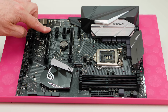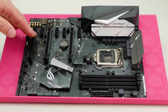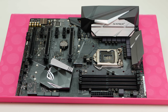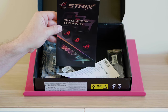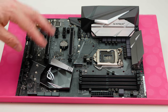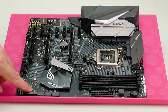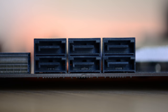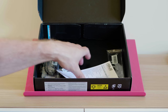You have two PCIe x16 slots, both reinforced — running at x8/x8 together. There's also a x4 PCI Express slot and smaller x1 PCI Express slots, so you're well covered for CrossFire and SLI. Two M.2 slots — one here and one here — supporting all M.2 sizes, which is where those extra lanes come in. And six SATA ports; they've removed SATA Express and other superfluous stuff that never gets used.